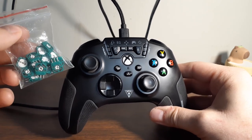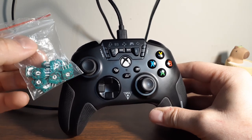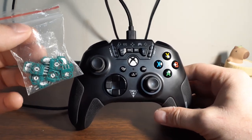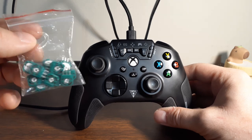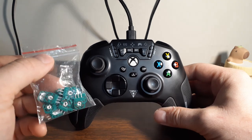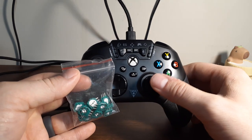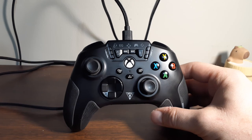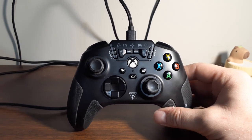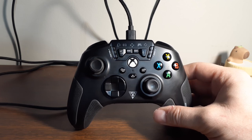If you've already worked on controllers at all, you know that each joystick has two of these potentiometers or omni sensors, whatever you want to call them. There are fixes on YouTube where you can flex these little green plates open and pull the little sensors out and replace them. I've had some success doing that on Microsoft controllers — I actually replaced a sensor on this stick as well — but the recalibration can be a much easier fix for your stick drift.